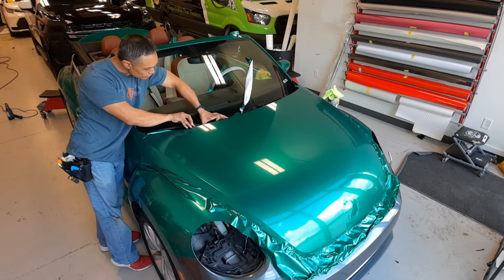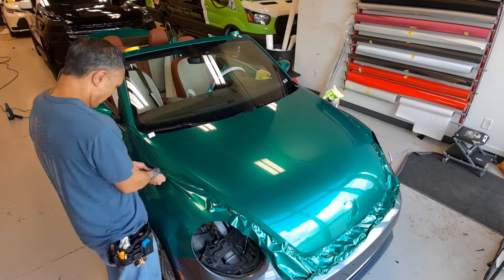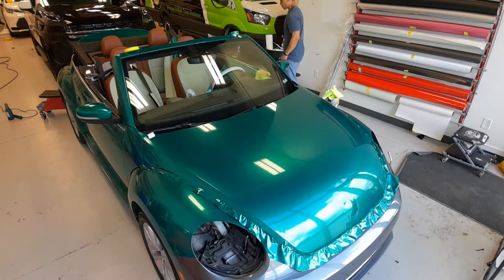Because I didn't roll that vinyl down, I'm basically able to cut with the side of my blade up against the back underside of the hood. That way I have nice coverage all the way over the edges and it looks like it's paint.